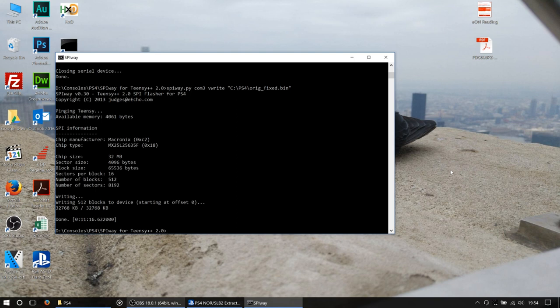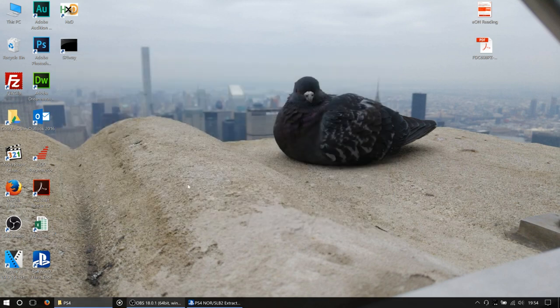Alright, okay then, ladies and gentlemen, so you can see there, it took 11 minutes and 16 seconds in the end. So that's all fully written back to the chip, and of course, because we used the verify write, we can be fairly sure that what's in that bin file is on that IC, so that's great. So we're going to eject that now. And once we've done that, of course, we are free to go and reinstall this chip back on our PlayStation. So that's what we're going to do.